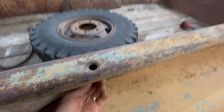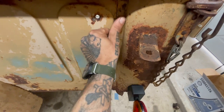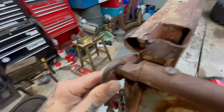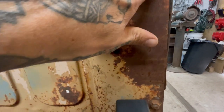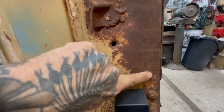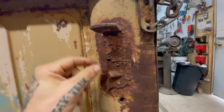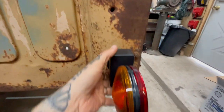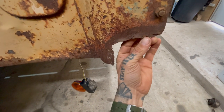In the back, same thing — you've got the corners, and of course that brings the tailgate into question. The rear corners are similar to the front, with spot welds up to the rear panel where they all meet. There's also an add-on here, but this is actually the original taillight bracket — that's where the original taillight would go, so we need to weld something in and patch that.